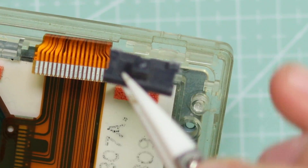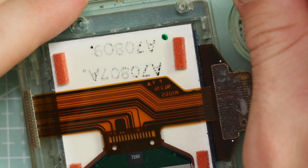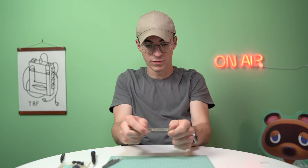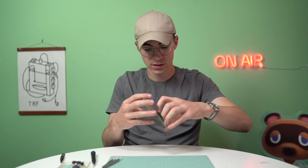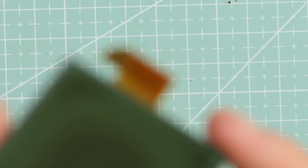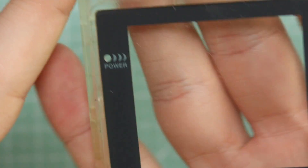Power switch looks okay. Last but not least, the screen. This isn't a massive worry because it's already quite damaged — I'm just going to very gently twist the shell side to side and it will pop up like that. That actually does look like it's the rear protective film and polariser that's burnt, so that's going to be an absolute nightmare to fix and then you'd still have to backlight it because you've removed the reflective film. But here we go — that is the shell all stripped down. We're going to give this a nice clean. I'm really pleased with this so far — it does look like it's going to come out quite nice. The shell is a little bit yellowed but not too bad.